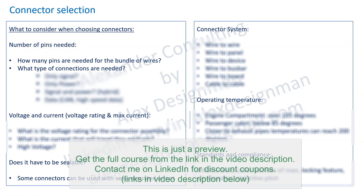You don't just put connectors in a vehicle — you have circuits that need to be routed from one place to another, coming from different departments. You need to check how many circuits and wires you have, and whether you can reduce them. If you need 10 wires, you need at least a 10-pin connector. However, you should choose a connector with more pins — perhaps 12, 13, or 14 — because you never know when an update might add more wires. It's important to add 20% extra pins as a buffer, based on experience and discussion with the team.